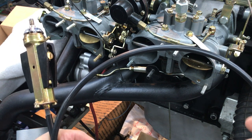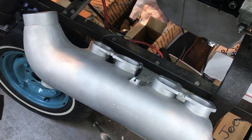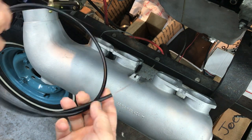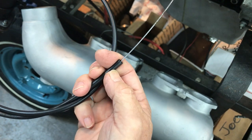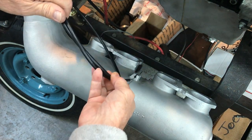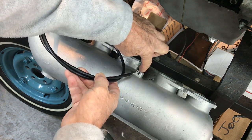That's cheaper than trying to replace the whole unit. What the cable and sheath does — pan down here — there's your air log. You trim back a little bit of the casing on the outside and you have the spiral round casing underneath, and that goes inside here and attaches with a set screw — a Phillips machine screw right here.